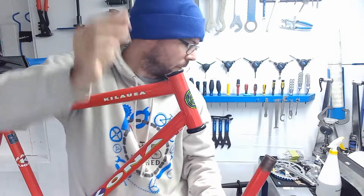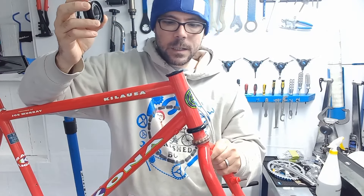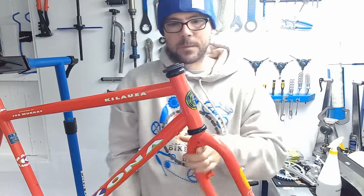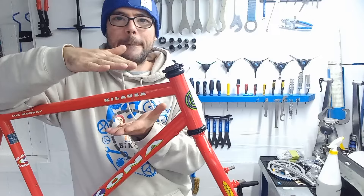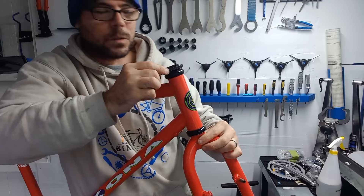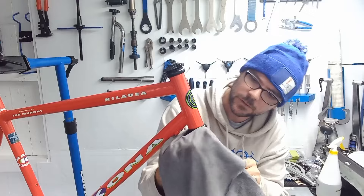That's been painted — no need to put any grease on there, just a little bit of copper slip on the threads to stop rusting, and then there's the rest of the Impact headset. We'll get this on — oh, that's feeling nice. Like bottom brackets, you shouldn't have to force it — it should just slip in nice and easy. Nip that up. I'll just tighten it a little bit; I always like to do fine adjustments on the floor, then wipe off the rest of the grease.